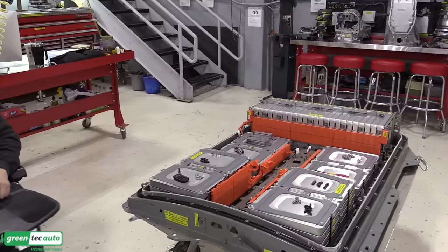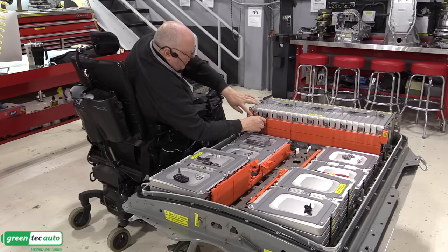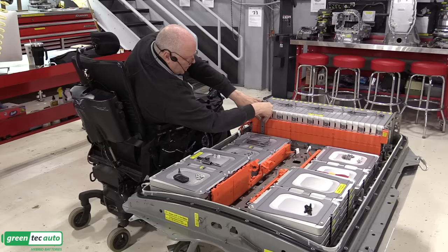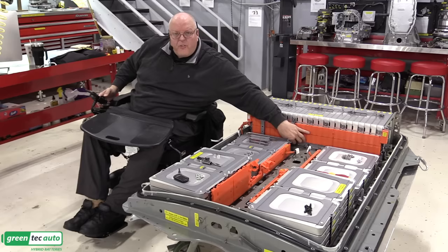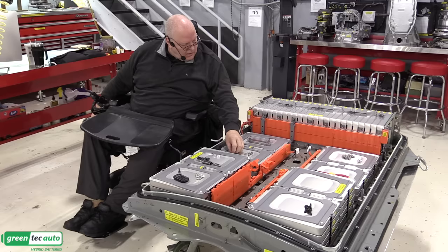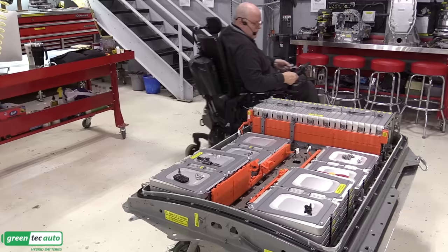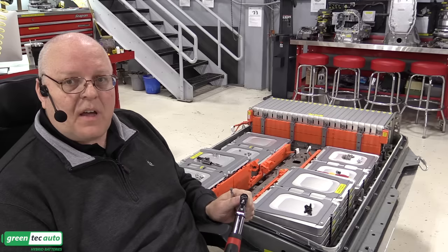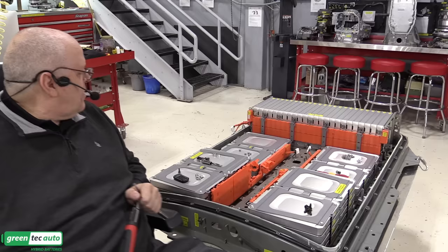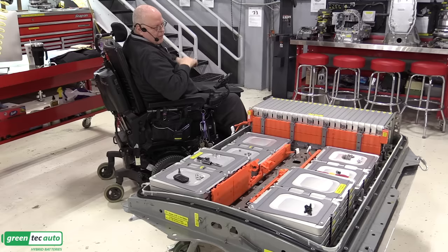So there are four vertical brackets that use the dark colored nuts to be held in place, and they go every other set of studs. If I would have been thinking, I would have put these brackets on first before putting the battery stack down in the battery tray, but I forgot. All the rest of the brackets that go on here and the ones I just installed have the same tightening torque of 9.6 Newton meters or 85 inch pounds. We have to tighten or torque these brackets first before we put on the next brackets.